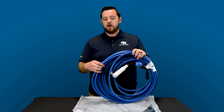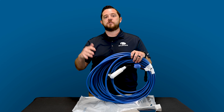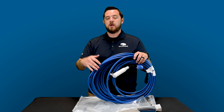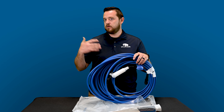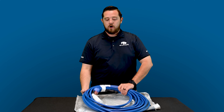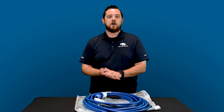I don't really want to cut too much into this — I just want to show you guys the actual full cord. Really heavy duty material on these things. This is transmitting actual directions to the cleaner, so this is a power and communication cable. You want to make sure before you're tossing these in that every one of these hoses looks good — no cracks, not broken, no exposed wires — because we all know that electricity and water don't mix.